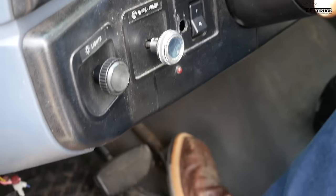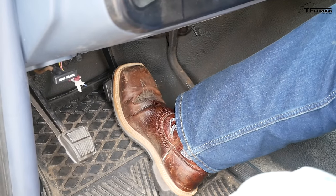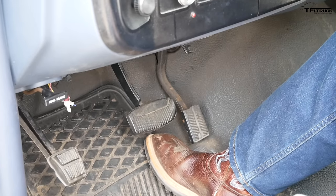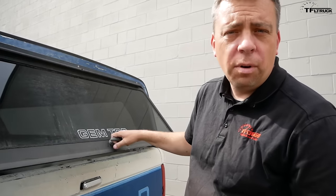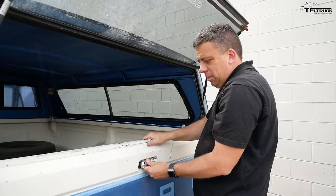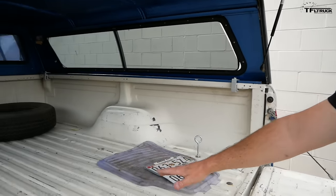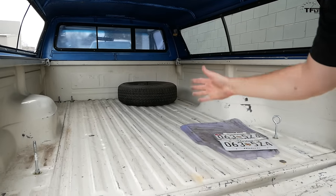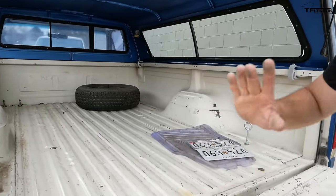Very simple — you have a foot emergency brake with a brake release. Not everything is perfect though: look at the travel on this brake pedal, it's about a mile away. We fixed this on Gun Smoke already; we might need to bleed the brakes on this one too. As far as we understand, this truck started out in Maryland but spent a lot of its life in California around the San Diego area. The reason we purchased it is how solid everything is — the bed on this 30-year-old truck barely has a few scratches. It's an eight-foot bed that you could turn into an overland rig, and it could probably go another 30 years with no issue.